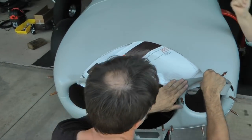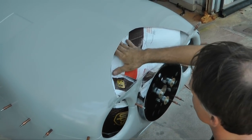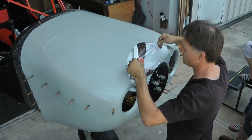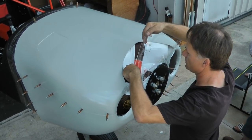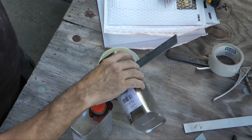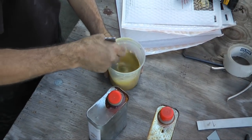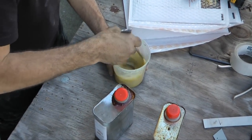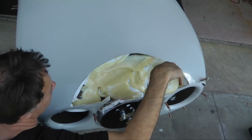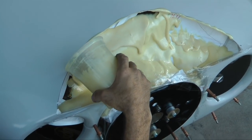In this scenario, the front top of this cowl was not the right size and shape for this engine. The front top was cut away and now we will create our own custom nose using the polyurethane foam. Note the engine is covered in plastic so the foam will never touch the engine while it sets up. Plastic tape can also be used to form a protective barrier. You can also use this process for a repair where a large area is damaged or missing, so you can restore or recreate the shape for the fiberglass.